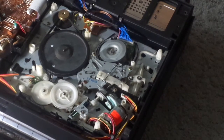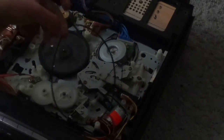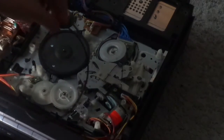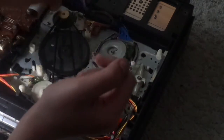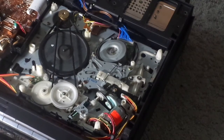Since I have a belt that will work fine with this VCR — this is a better belt, and this is the one I was using all this time. It looks a little bit shiny, but that's because I put some grease on it. That's because I was trying to grease the gears on the VCR. All I have to do is just replace this belt, and it's pretty easy to do. The most common problems with VCRs are basically a capstan belt and maybe the loading belts. The loading belts are right there — one of them was worn out, so I had to replace that.